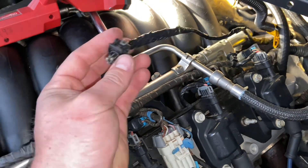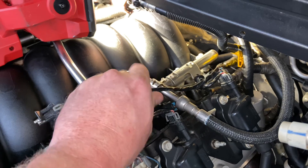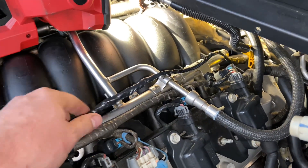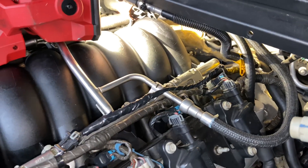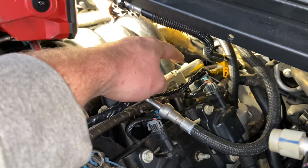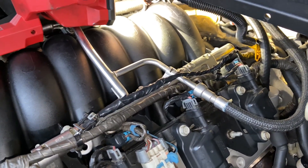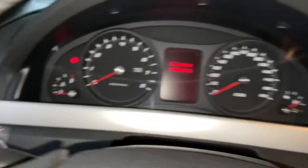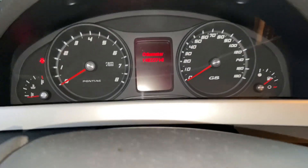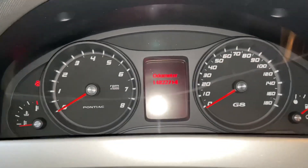It's been a headache. So I got my oil pressure sensor — got a little electrical tape around it, wire nuts in there — just kidding, I got it crimped. It was pinched right back there between the bell housing and the motor. About to plug it in and crank the car. I'm pretty sure — I really hope — that fixed it. We'll see right here as soon as I turn this key on.